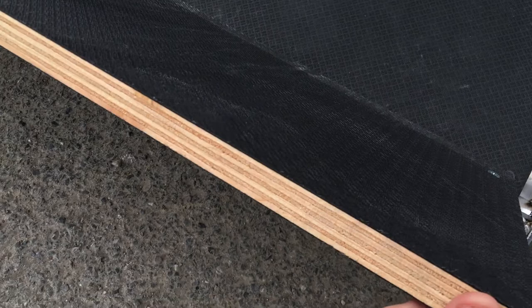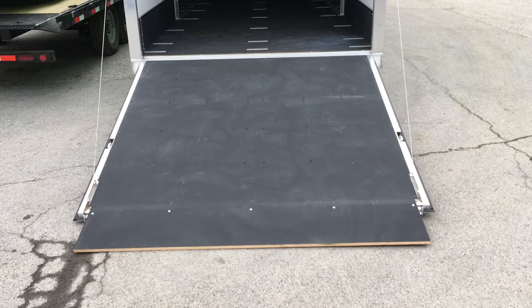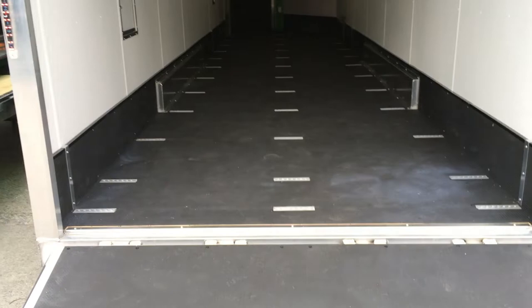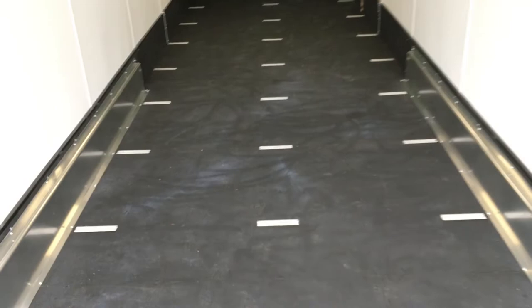The Nudo is done at the plywood manufacturer. The nice part about this is it's commercially done by the flooring manufacturer and is actually relatively inexpensive because there's less labor at the trailer manufacturer — they're not laying a second substrate down and putting vinyl between it. Neo also puts tracking in the floor — a very nice setup. The tie-downs are designed to run with each of the floor cross members, and each one is lagged into the 4-inch box tube floor cross members with three lags.